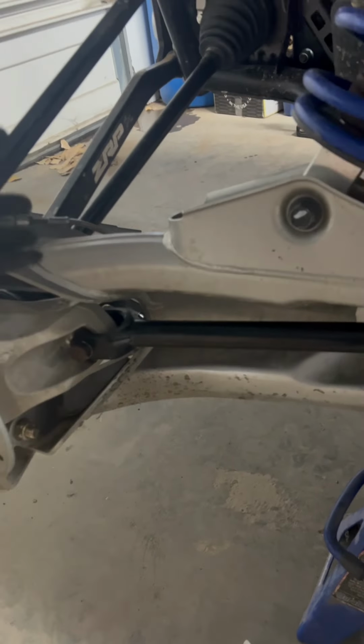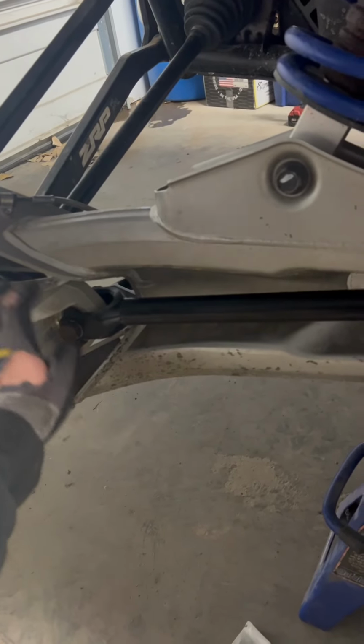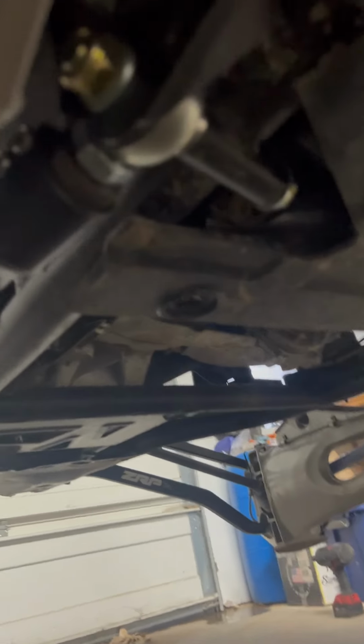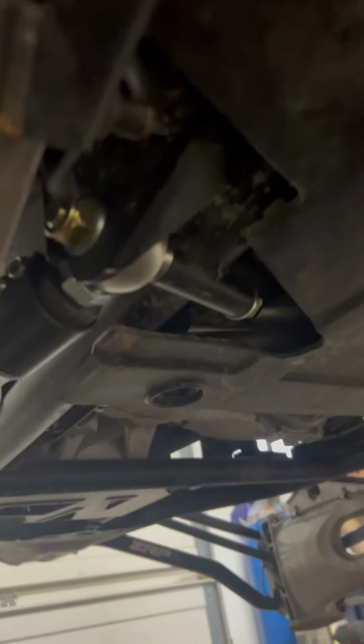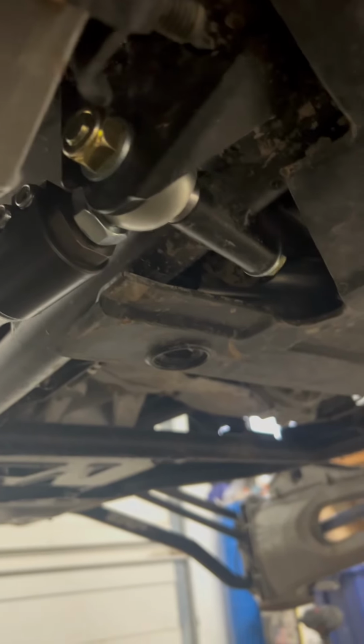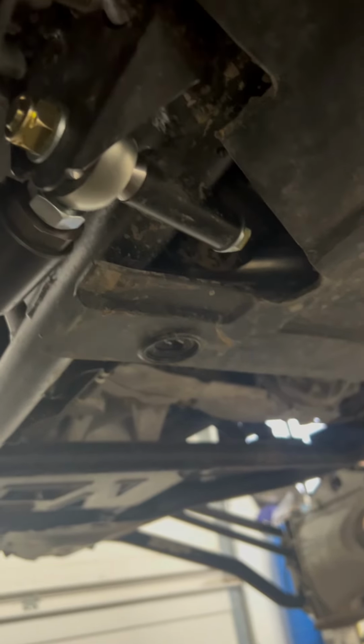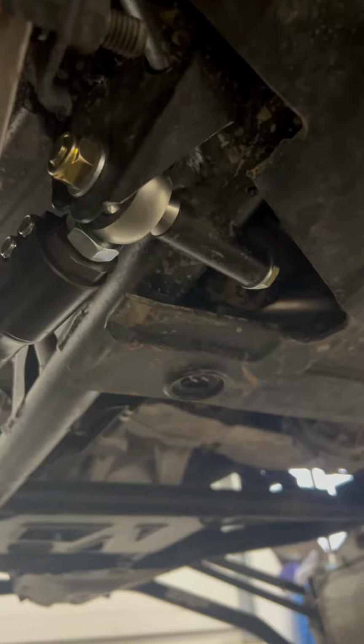It's ready to go. This is a 22 millimeter, with the nut on the back a 22, that comes supplied with the link. And then we have the ZRP bolt kit, which I highly advise you do. Like I said before, it's just a better setup. It's not going to be popping and clacking around. That's going to be a 22 millimeter up there as well for the wrench and socket. And if you use the stock bolt, it's going to be a 21 millimeter.